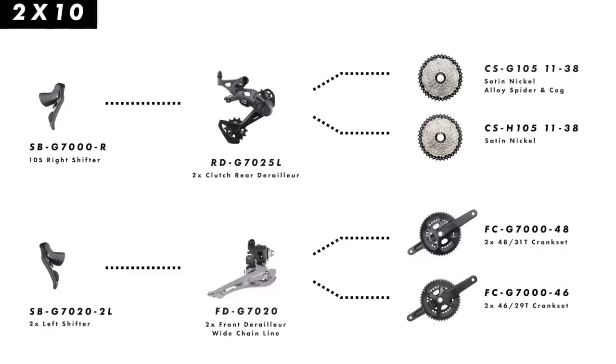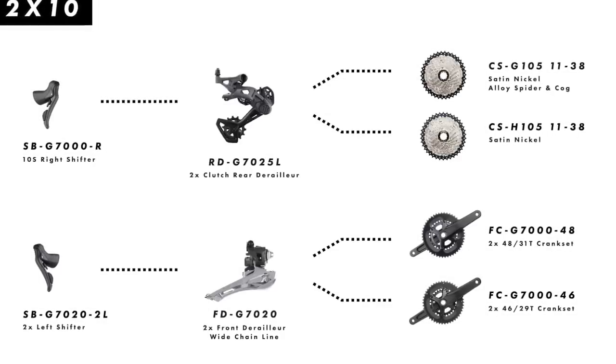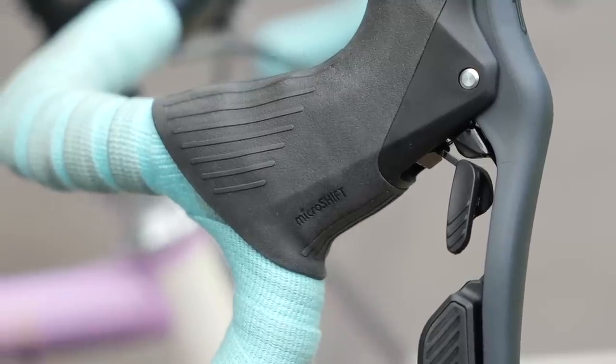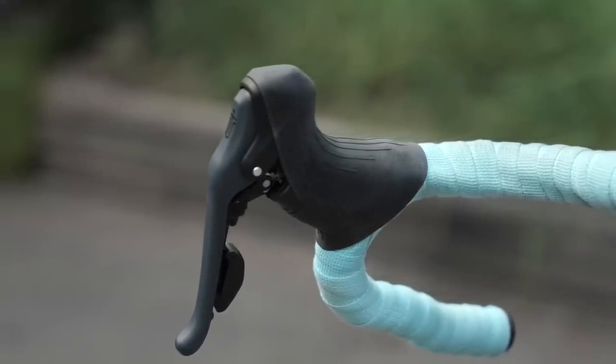The 2x version looks promising, but this is where I think they could have gone a little more experimental — gotten a little bit more weird. Maybe offered a wide-low 40-24 old-school mountain bike double option for those doing hardcore touring with a lot of gear. I think the 40-24 paired with their 11-to-38 would be an awesome sub-sub-compact setup. This is where Sword is a bit of a conundrum: is it meant to be an all-mechanical GRX or a budget alternative to Shimano? I'm stoked that there's still an option for those who want to run cable brakes — it's a definite hole in the market. But I do wish they got a little bit weirder and offered gearing options that didn't mimic the bigger brands.